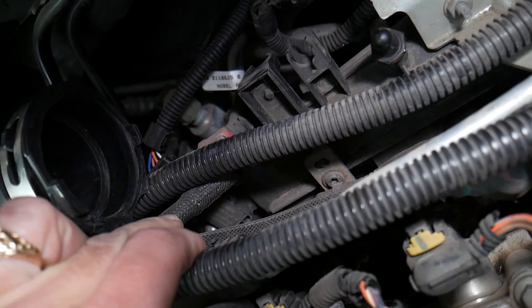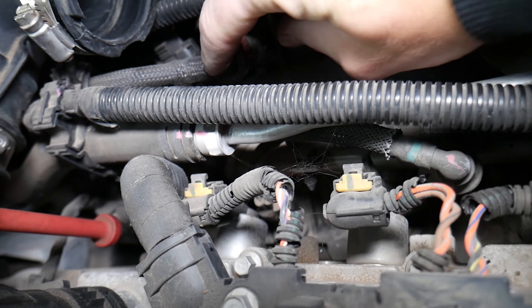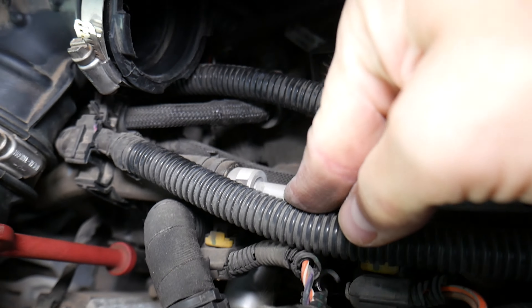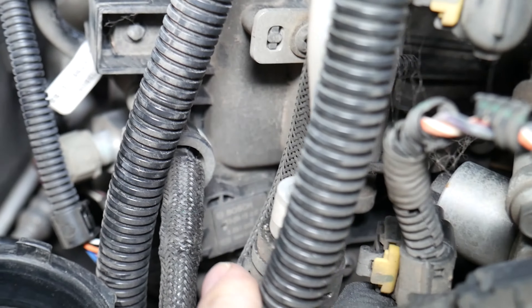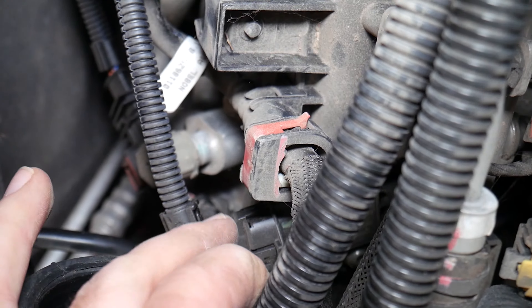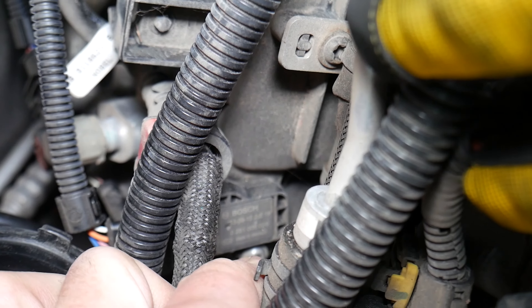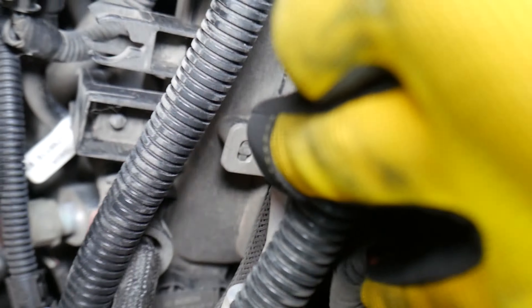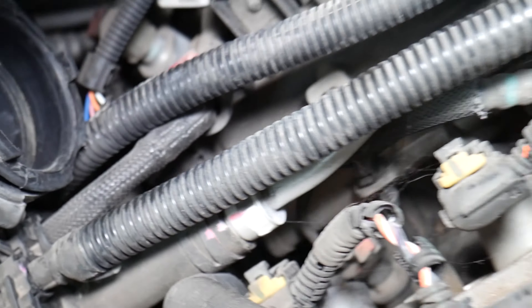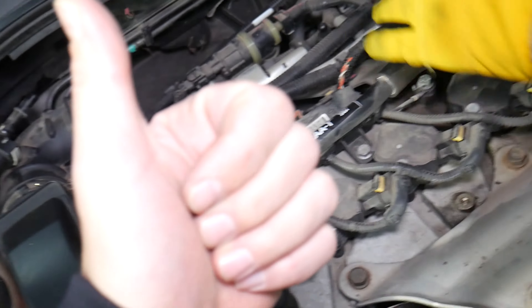Once you remove it, you come right here, all the way towards the back — that's where your MAP sensor is located. Let me move a few lines out of the way. Right here you can see the Bosch — that's the turbo MAP sensor, and that's the connector on the back side. That's the sensor; it just has one bolt on the back side that holds it in place. Once you remove that bolt, you just pull it out — it's a vacuum sensor and it just comes out. For any of you that need to replace it, that's where it's located.